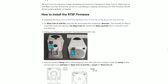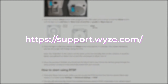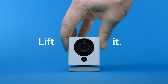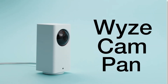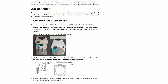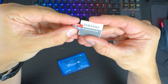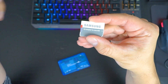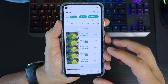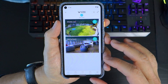Setup is very straightforward. Wyze shared a link to their new firmware with step-by-step instructions, which I've included in the description below. The firmware supports Wyze cam v2, Wyze cam v3, and Wyze cam Pan. For this video I'm using my Wyze cam v3. The first step was to download the firmware from Wyze's website and transfer it to a micro SD card. It's important to make sure you follow the specific instructions for each device as they're slightly different, and the camera should already be connected to your account via the out-of-the-box setup process.